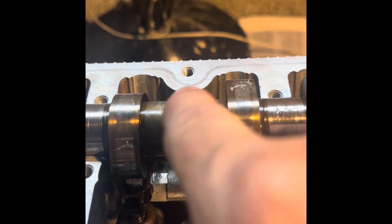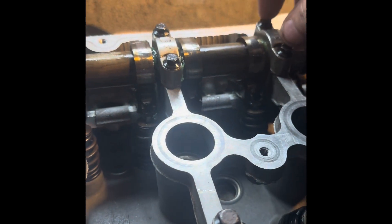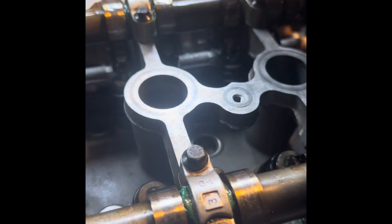So that's the camshaft sorted. I'm going to put some lube on there and assemble it. We've dropped that in there - make sure you've got it right in there. You're not going to get it spot on until it's fully down. So now put more lube on those and start doing them up, torquing to 10 Newton meters. This is the one that's pushing down so be careful - don't give it loads of jip here because you need to pull it down gently. Just gently pull them all down so they're all fast, then 10 Newton meters with a bit of Loctite.